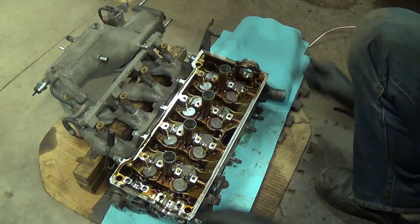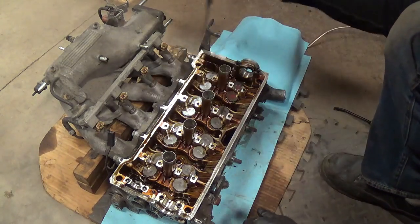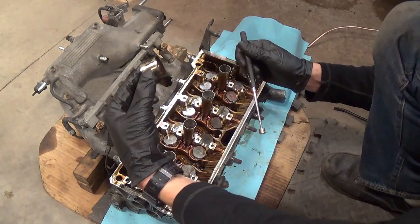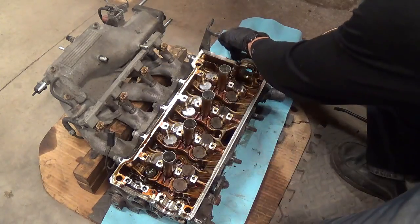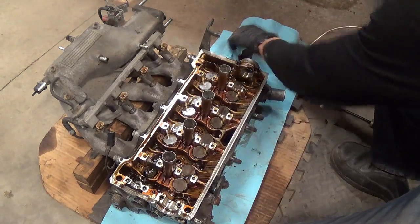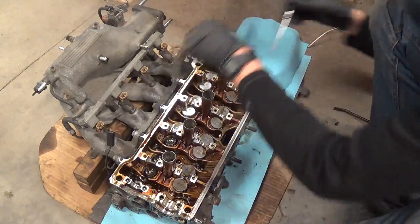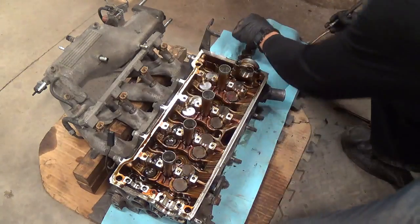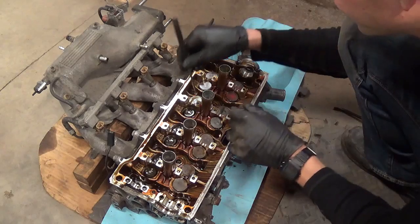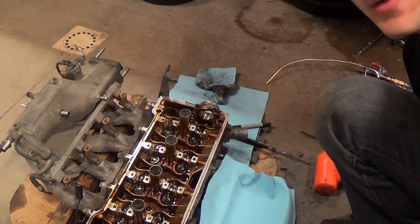It's on a soft pad on paper towels so the mating surface doesn't get damaged in any way. Now what I want to do is take out these shims. They're actually cups with shims installed on top. I'm going to put them in order because the clearances are valve specific. I'm going to take all the buckets out so they don't fall out when we're flipping this head over, putting them in order on my magnetic tray over here. All right, we've got our buckets out.